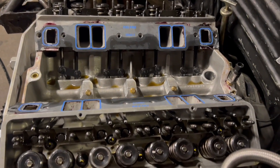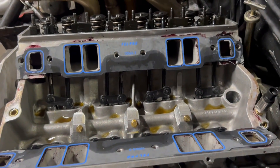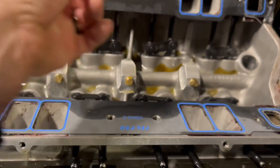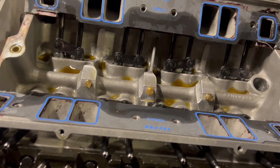One other thing that may be a sign we have a lot of oil in the intake valley — look how wet this gasket is. I honestly never paid attention when I pulled the other motor apart, but that oil level goes up to about right here. The lifter valley should not be that full. I guess it's possible with all the steam and exhaust gases trying to come up from the bottom. Alright guys, comment, like, and subscribe — we'll see y'all soon, I'll let you know how it goes.